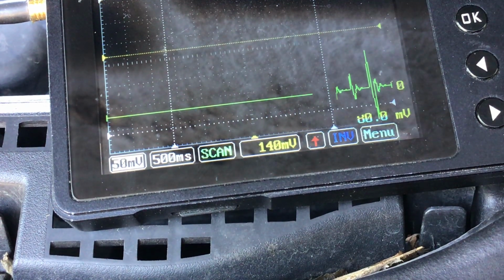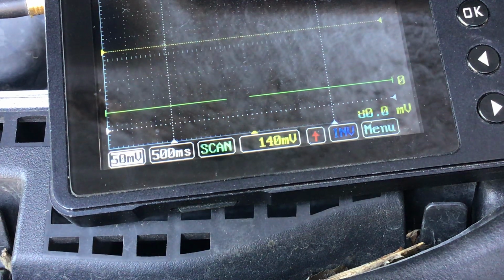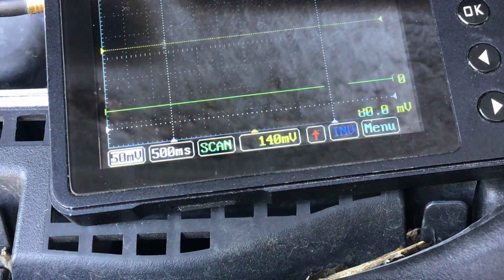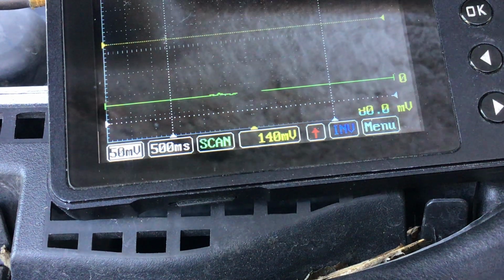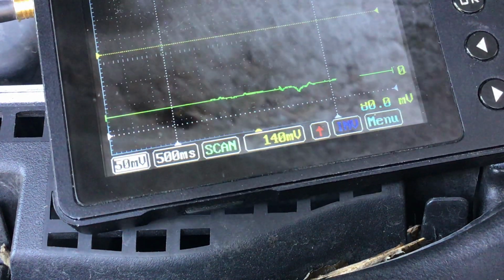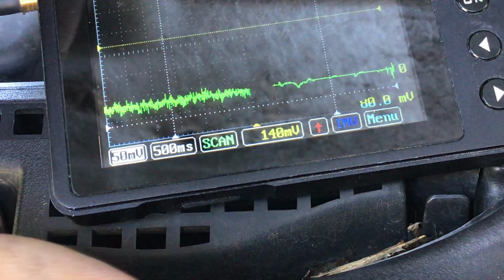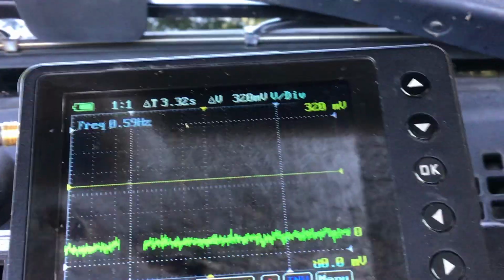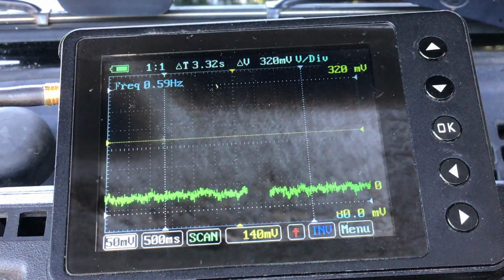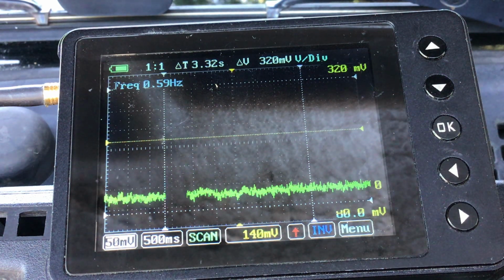So this is a quick way to check this out. I have to switch my transducer leads to look at the intake, because I am dealing with a one-channel scope. It's a very good scope, so I just switch my leads over. I'll take my leads off, the BNC lead going to the rear. So I'm strictly looking at intake now. Okay. Looking at intake. I will pump up. Maybe we're in overlap. I see nothing.